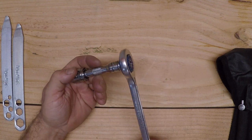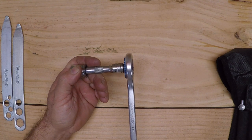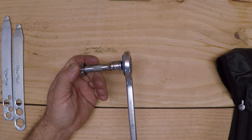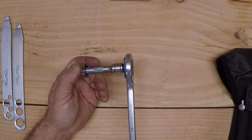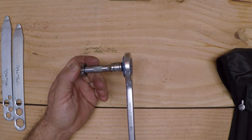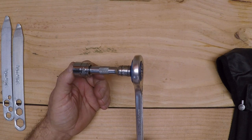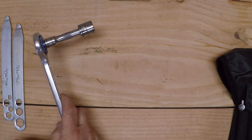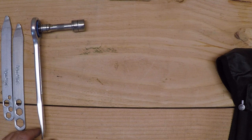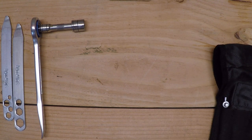With this setup I'm able to do it. I have a 50-tooth rear sprocket and a 116-link chain. With that setup I'm able to run a 13, 14, or 15-tooth front sprocket. This is on a KTM 500 EXC. It's a good setup — I've used it many times and it works in the field and in the garage.